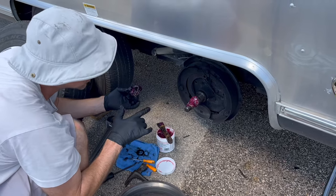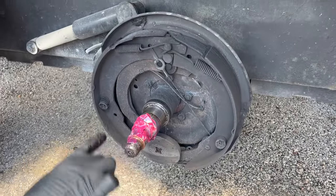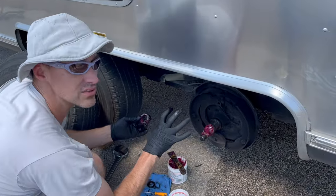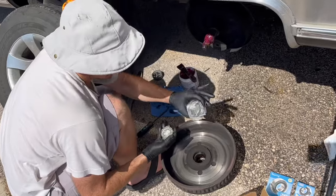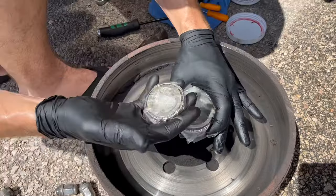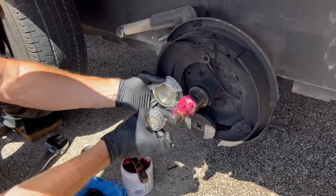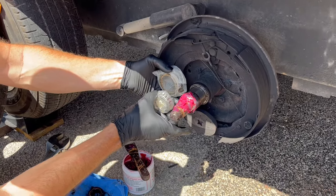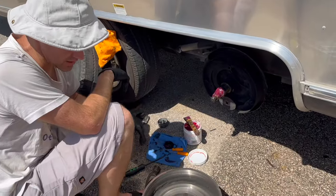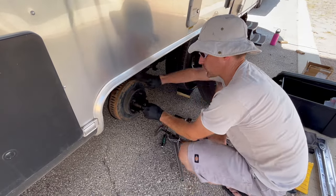There are a couple of telltale signs here — the number of bolts that hold it on. Newer Airstreams have a completely different bearing and grease situation. We should be able to identify these just based on what this looks like. Looking at the back of the drum, this is the inner bearing. The outer bearing goes on the bottom and they stack on the spindle — inner bearing on the fatter part of the axle, outer on the thinner part, both nested in the brake drum. We carry a spare set at all times.